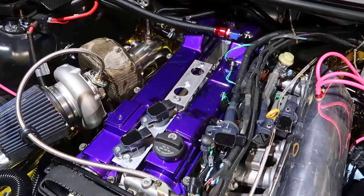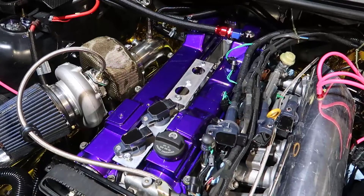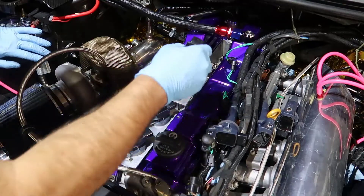I made six spacers, all the same size, to keep the plates at the right height above the engine. This means I don't need to worry about squeezing or touching anything. I also need to poke one more hole per plate and install a rivet nut, which will be used to screw the coils down to the plates. So we'll screw the plate solid, then screw each coil onto the plate using the rivet nut.